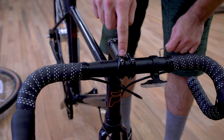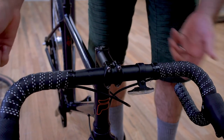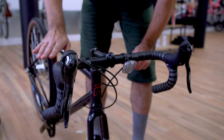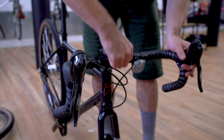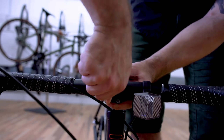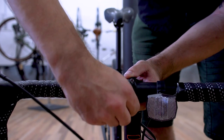You want there to be an equal gap on the top side as there is on the bottom side — just a small gap; you don't want to pinch one side. Before they get very tight, make sure that your handlebars are in relatively the correct position, so that the angle of the flat part here relatively matches the angle of the top tube. We'll check that once again before we're done. Go around snugging all the bolts up at the same time.